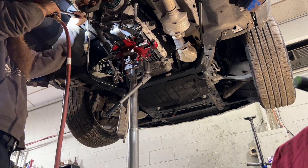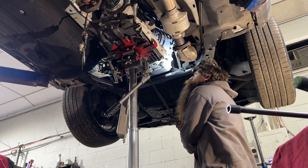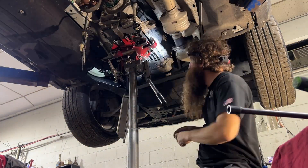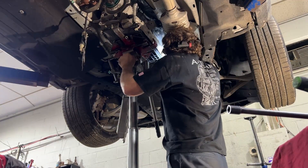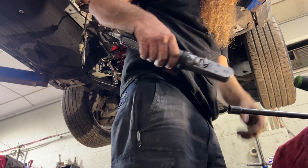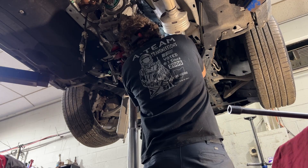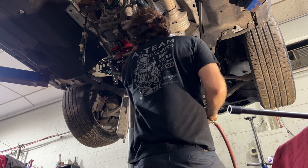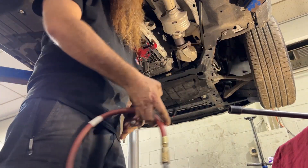It just came out of the left side. There's two of these long ones on the top. I'm going to finish twisting this bolt out. There's a bracket on that exhaust — I'm going to take it off because it will help me figure that bolt out a lot easier. It's in your way to remove it, 13mm. I'm going to move this from the right side there so I can get my fingers up there easier.